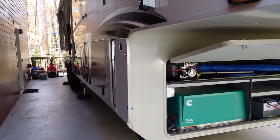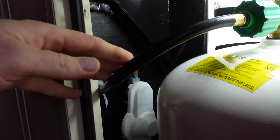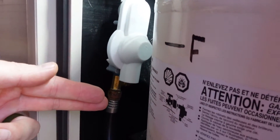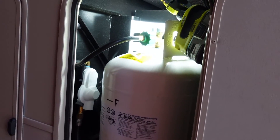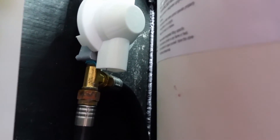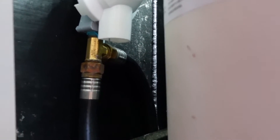Follow me over here to the passenger side, and let's take a look at this third propane tank. I've got a bright light in here to help us see everything. But like any propane tank, you've got the line coming out — the gas line going straight into the regulator back there. And then you'll notice at the bottom of the regulator, there's a gas line coming out. I just assumed that that gas line ran straight to the generator, and thus this third tank was exclusive to the generator. At least that's what the tech told me during orientation. But take a closer look back here, and you'll notice there's actually a T coming out of the regulator. So there's actually another gas line there, and I never really noticed that until yesterday when I took a closer look when the generator kept on running.